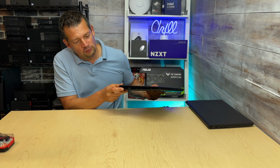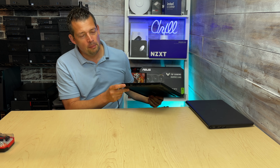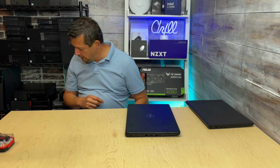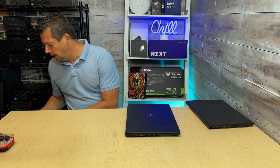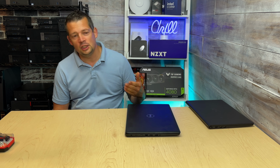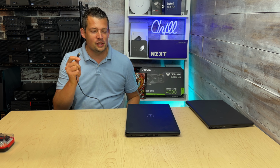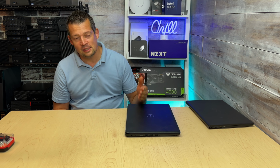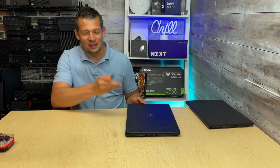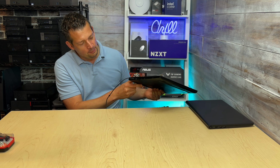There is another option. If you have a laptop with a USB-C port, that's not just a data port, it's also a power port. Almost all of them are capable of receiving power. So let's see what would happen if we had a charger and just plugged it in. What if you don't have a Dell charger? What if you have an HP, a Lenovo, or an Amazon Kindle charger? Anything with a USB-C, even if this laptop has a 65-watt charger, if you have a 35 or 45, it will start charging. It can bring the device back on. So let's plug this in and see what happens.